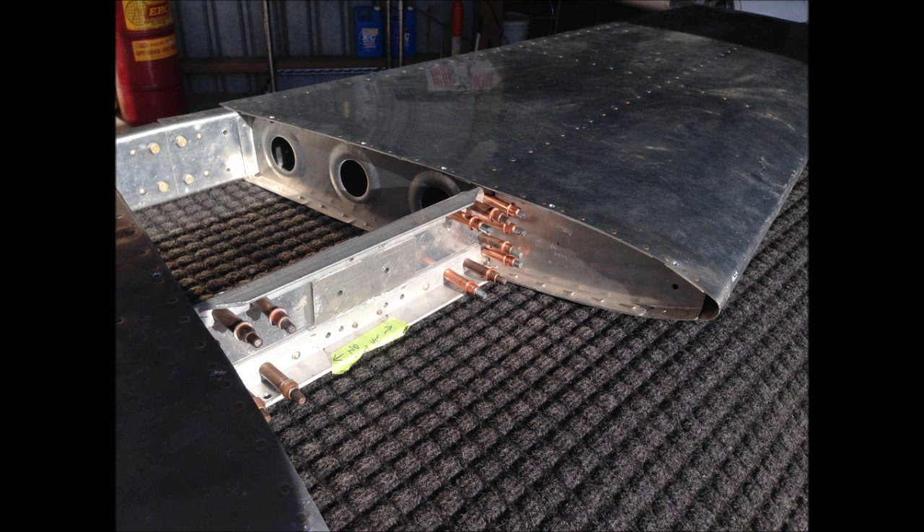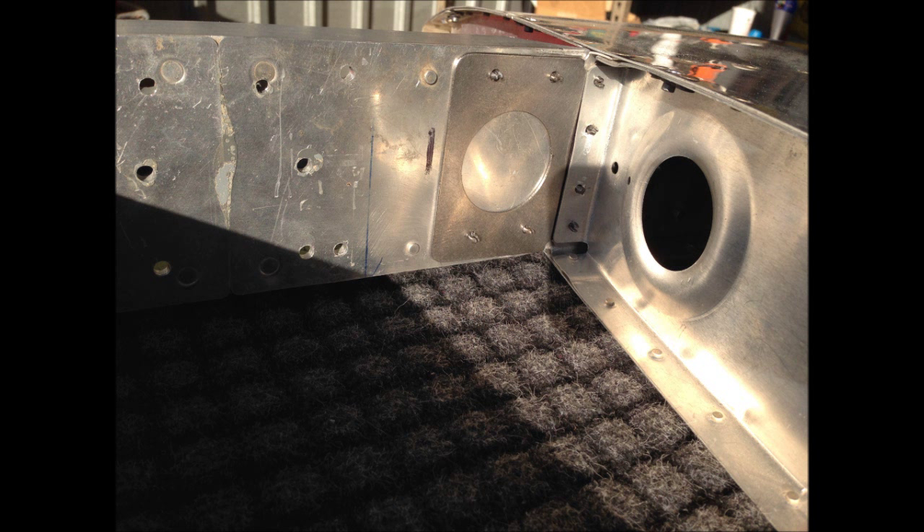If you look closely, you can see the notches we put in the stainless part — one at the top and one at the bottom. Those correspond with the notches in the spar where the cracks were occurring. Our notches are roughly a quarter of an inch deeper than the edge of the spar, so later you can remove your fairing and check to see if your cracks have stopped, or verify that no cracking is occurring because you're not really covering up the area.